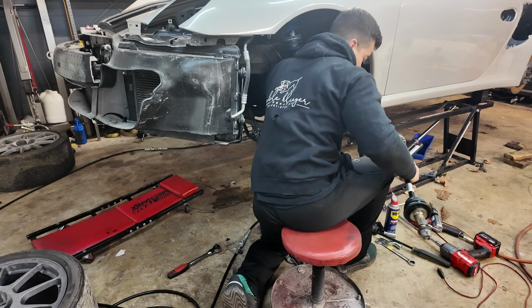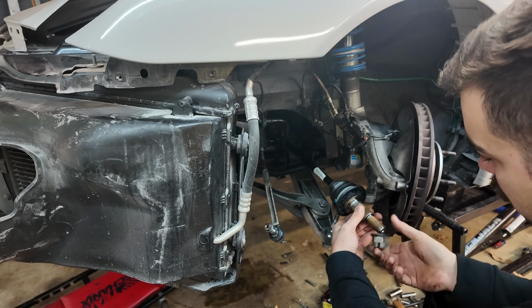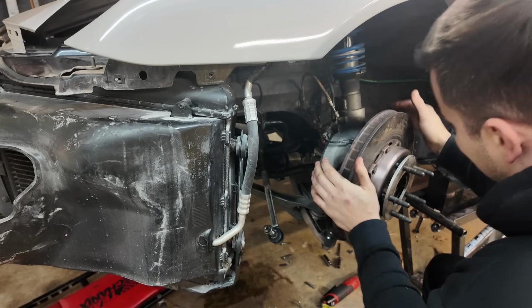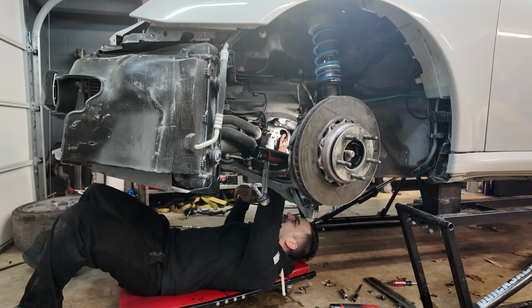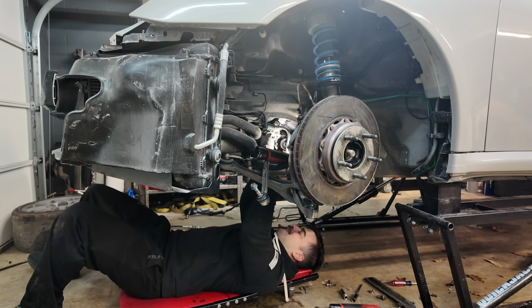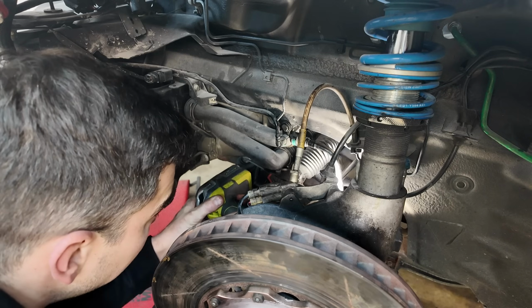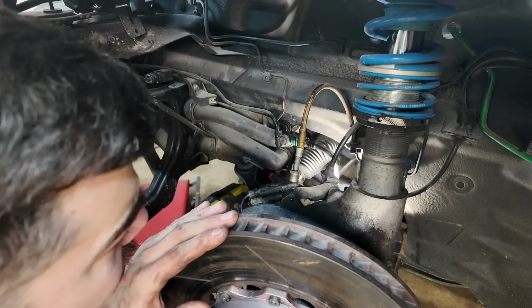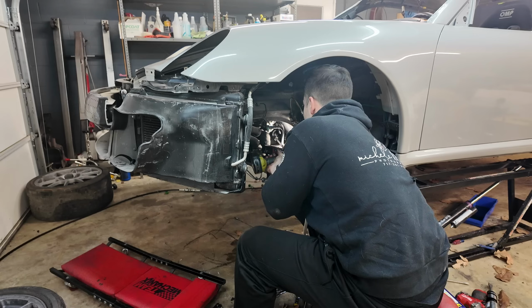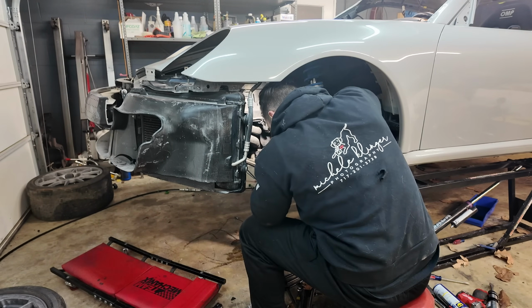Make sure that's seated. Now I know I could have pulled the whole axle out with the stub that goes into the differential as one unit, but I didn't want to lose all that diff fluid. I wanted to keep them separate, and this turned out to be an easy way to do it with this new powerful impact. And here I'm using my old Ryobi impact because I didn't want to over tighten these. That's done. Now I can get all my suspension put back together.